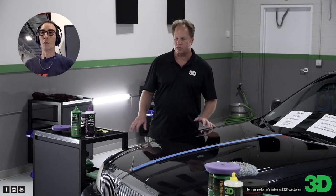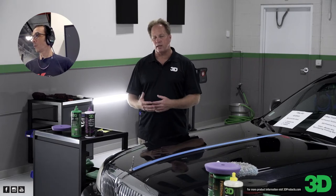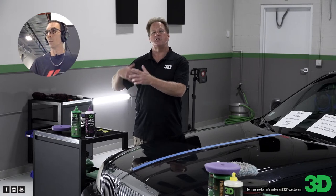When it comes to pad choice — if it's a microfiber pad and you're trying to do a one-step, just do a test spot first, inspect it closely, and make sure the fibers of the microfiber pad aren't cutting the paint and leaving micro-marring. I was at Meguiar's when they developed and introduced the microfiber DA system. The whole reason behind that was to get guys off rotaries so they weren't putting in holograms and burning edges. To do that, they needed to amp up the cut you could get from a free-spinning DA, so they introduced a fiber pad. The fiber pad always offers more cut, but because it offers more cut, it also has a tendency to leave micro-marring in the paint. If the goal is to do a one-step, do a test spot first. If you are leaving micro-marring, step it down to a foam polishing pad.